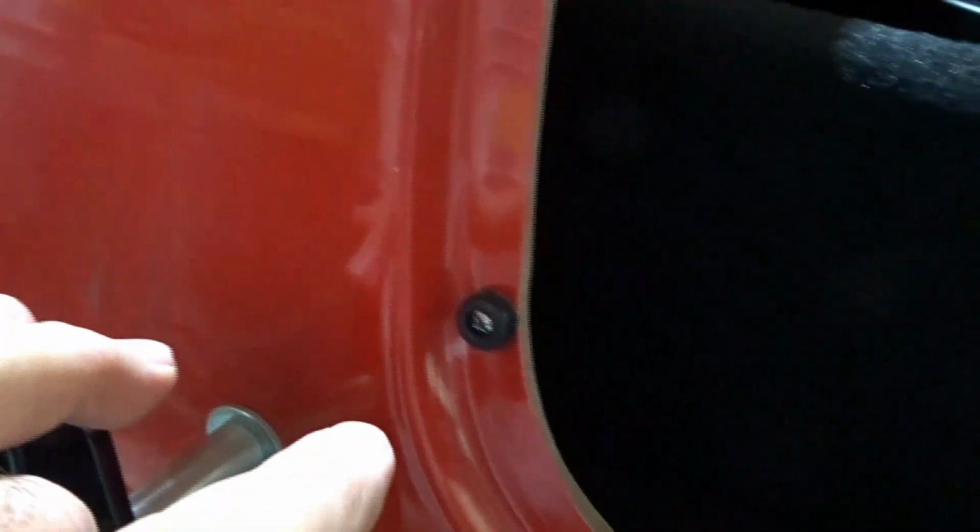But you can see I've got a couple of bumpers mounted, one on each side here, and one up here behind each of the hinges. And that's just so that the trunk deck lid kind of falls in place in the car where it needs to be, but I'm not going to put the weather seal around there, because I'm going to let the owner decide if he wants to put it on. He can pull the bumpers off, he can put the weather seal on. I don't think he's going to be driving in the rain a whole lot, but I want everything to function. So I want it to close and open, just like I said.